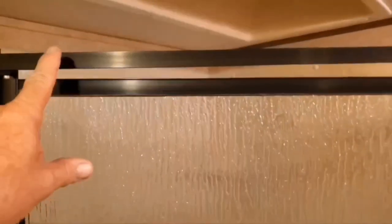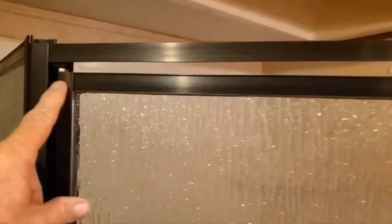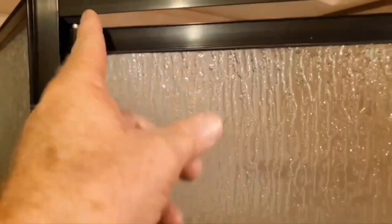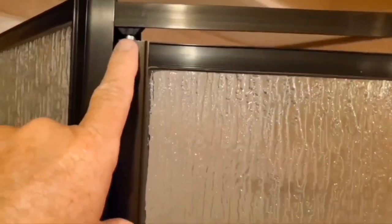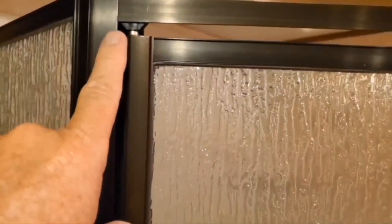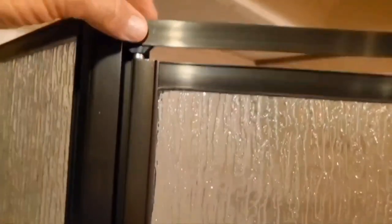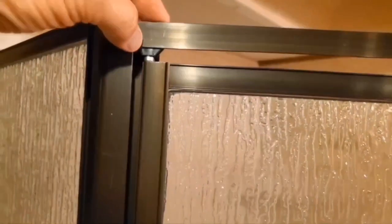the plan is I want to take that piece here where the door is screwed into it and see how far I can move this over this way. So what I might have to do is take it and TIG that hole closed and create a new hole. Because this gap, when it gets down to here, is a lot smaller. See, my finger doesn't fit in that gap, but it almost does up here.